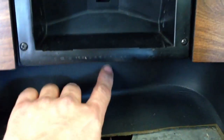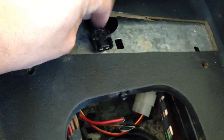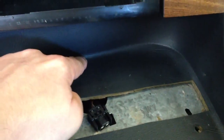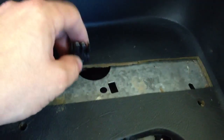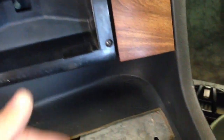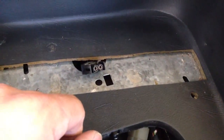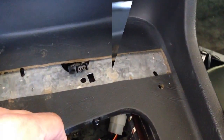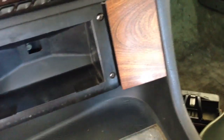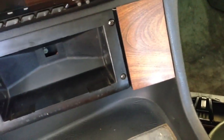Right at the bottom of the ashtray, right here in the center, there's a little hole that you can feed the connector through. There's another one back there that you can feed it through. I just took the connector out so I can plug it in, because I don't want to be fighting under this plate. I'm going to feed this one the same way — bring it out, connect it, and then put it back under the plate. There we go, I just made the connection. Once everything is connected, I'm just going to feed it back under the plate, and we'll be ready to go.